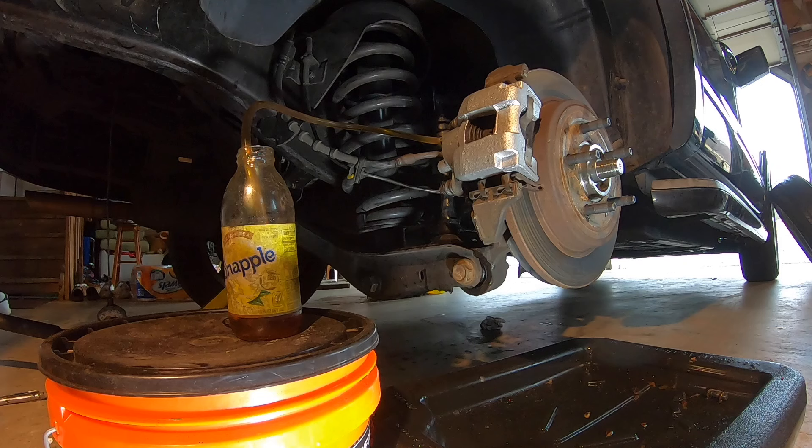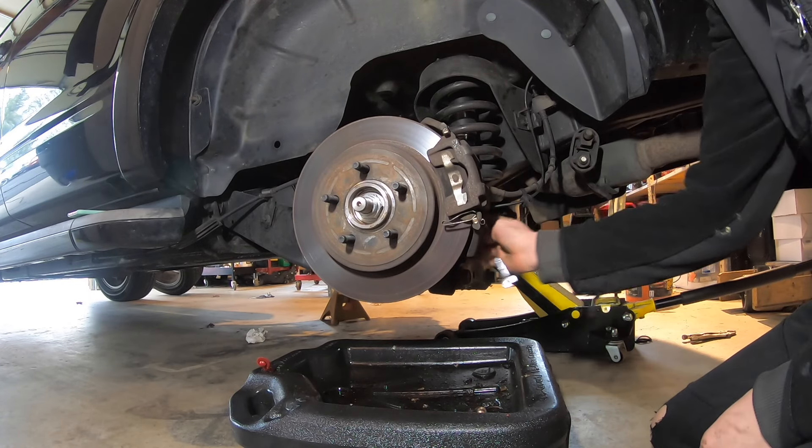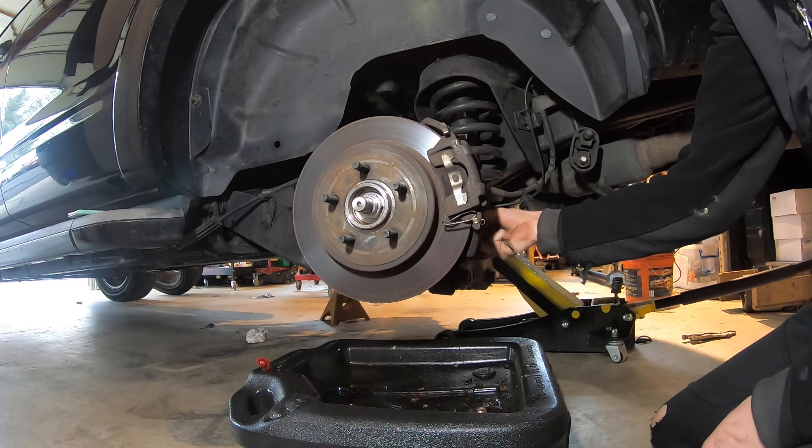This method is just easier. I'm going to go to Walmart and get some fluid and bleed the brakes out. I'm not happy with the condition of the fluid in the master — it doesn't look like it's ever been done. So I'm going to bulk up on DOT 3 and I'll be back to do the other side. All right, I'm going to speed run this side and see how long it takes me.